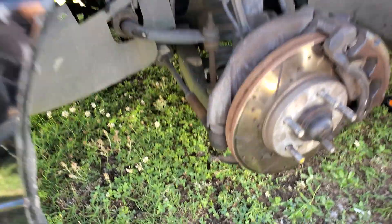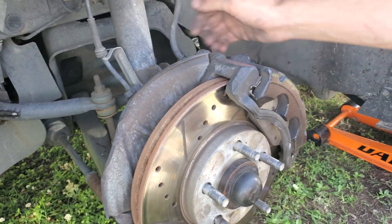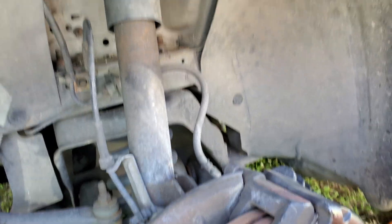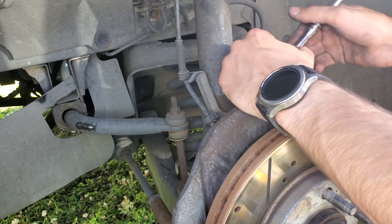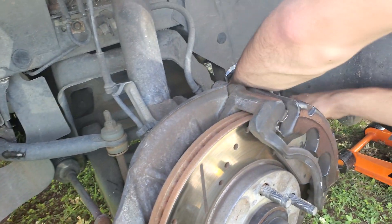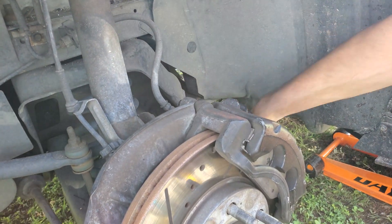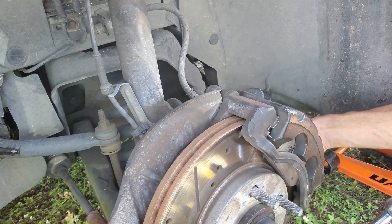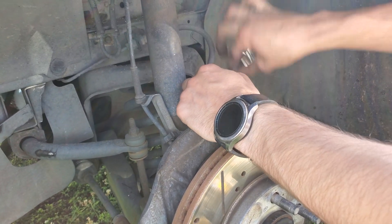Once you got your wheel off, first thing you have to do is take your old caliper off. There are two screws in the back you have to take off, and then there's one brake line in the back you have to disconnect because we're upgrading to braided brake lines. Just hit it like this and you already have it loose — same thing on the bottom. Don't unscrew one screw all the way before you have the other one loose, because the whole brake caliper is gonna wiggle around and make the screw harder to get off.